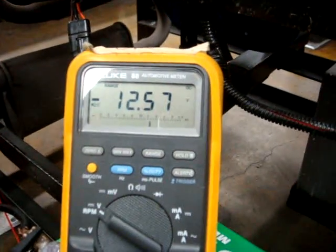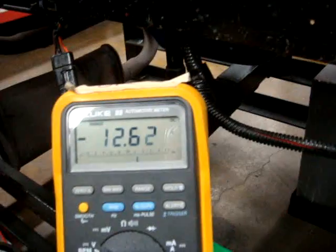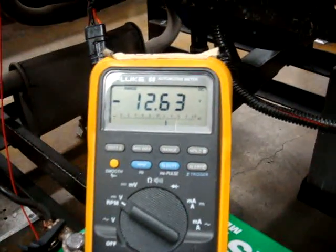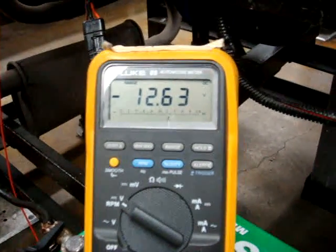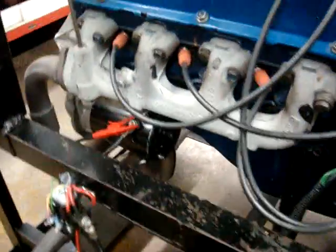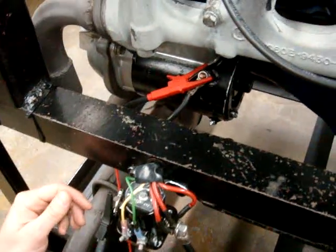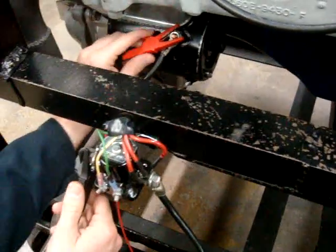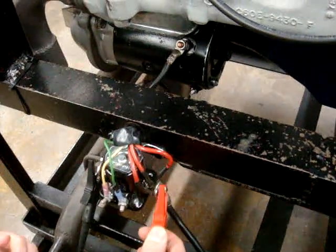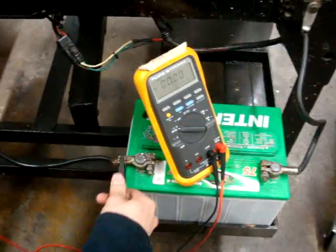Our spec on the insulated side is about 0.5, so that's good — it's below. Now if you suspect a high voltage drop between battery positive all the way out to the starter, you can go ahead and V-drop anywhere from V-plus out from the solenoid. We can also V-drop the solenoid itself, and from battery to solenoid.